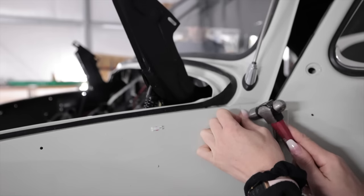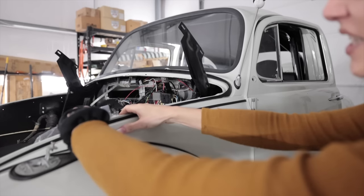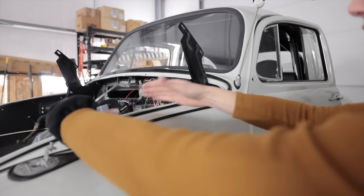Oh. I gotta open the carburetor and see what jets are in it. Frank at Turco said it should be 125s in the main and then a 165 in the secondaries. I'm kind of glad I decided to keep this molding right here. I was gonna delete it, but I felt it's supposed to have it.